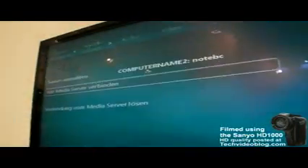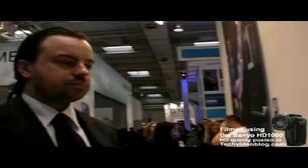The good thing about Windows Media Connect is if you have Windows Media Player 11 on some kind of PC — it doesn't have to be a media center, it can be any PC — the box will find that computer. This is just a standard laptop we have here, and I say connect. The box is now connected to that. So you don't need a special server program. The box can also connect to standard UPnP services, so you don't even need a Windows computer. You can just have a NAS with UPnP and that would work.